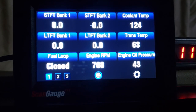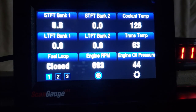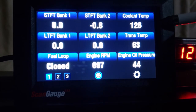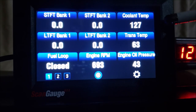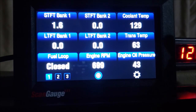We've also got coolant temperature, and what's so cool about this is we get a digital readout instead of that goofy gauge on the dash, because that gauge is not so reliable. The nice thing about coolant temperature being digital is you can also keep up with things like your clutch fan — it should kick in at 205°F. Without a digital readout you really don't know if it's working properly or not. So if you notice your clutch fan on the radiator is not kicking in until 210, 215, or 220, you know the clutch fan is getting worn and will need to be replaced soon. You can catch things early before they sneak up on you.